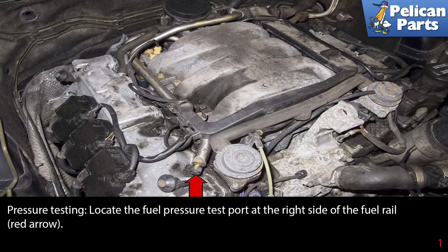You're going to be working with fuel here, so let's take some basic safety precautions. As always, you should be wearing safety glasses whenever you work on your vehicle, but now is a good time to put some gloves on to protect your skin. Work in a well-ventilated area without any form of open flame or heat nearby, including incandescent shop lights. If you smoke, now's a really good time to quit. Most importantly, have the proper type and rated fire extinguisher on hand and know how to use it.